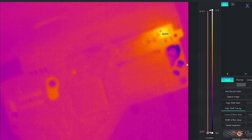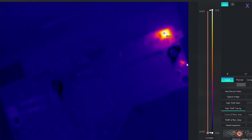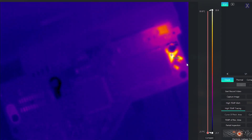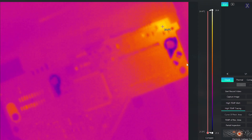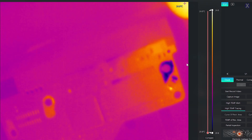We can see there's this area in the corner here — looks like one of these components is getting pretty warm. We turn it on again and there we go. We can see that's going, and that makes sense because that's close to where the power and data line area is. When you plug it in, it's usually close to where the plug-in is — makes sense because that's where power is coming from. So we can see the short is in this corner here.